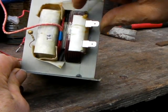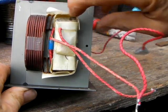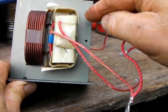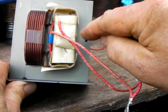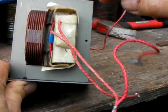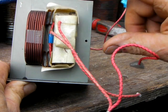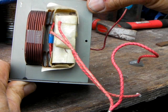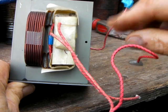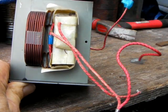The camera will pick it up — clear down inside there's a couple little packs of laminations. There's two of them side by side. What these do — they're shunts, and they shunt out the magnetic flow and make it take this path instead of the full path around the coil. The effect of that is when a load is put on the high voltage coil the voltage will drop. It's done that way because in a microwave oven there are varying loads presented on the transformer depending on what kind of food you have in there, so a simple way to regulate the power is to simply shunt it — when too much power is drawn the high voltage field collapses.